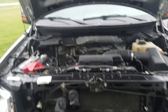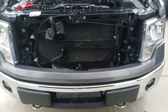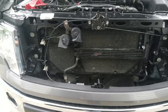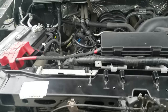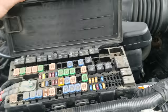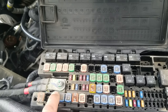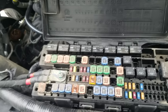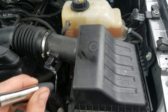This one's got a 5-liter engine. By opening the hood, the entire grille cover comes up with the hood, which is nice for servicing. Right here is our radiator, here is a transmission cooler, here are our horns, and this is our hood latch mechanism. Here's our fuse panel — you can see all the different fuses and relays. These are mini fuses, these are larger fuses, and these square black things are all relays.